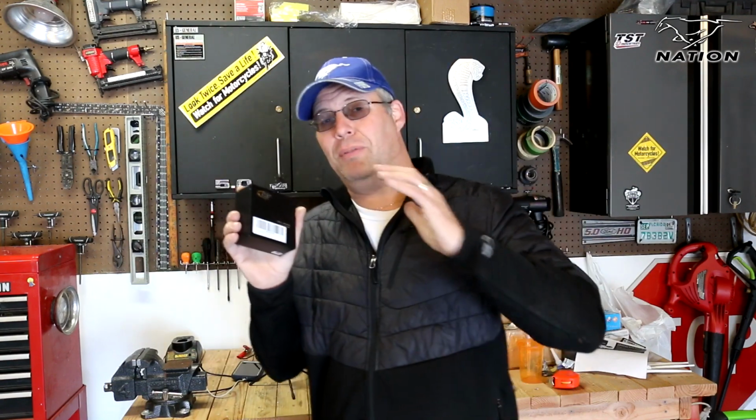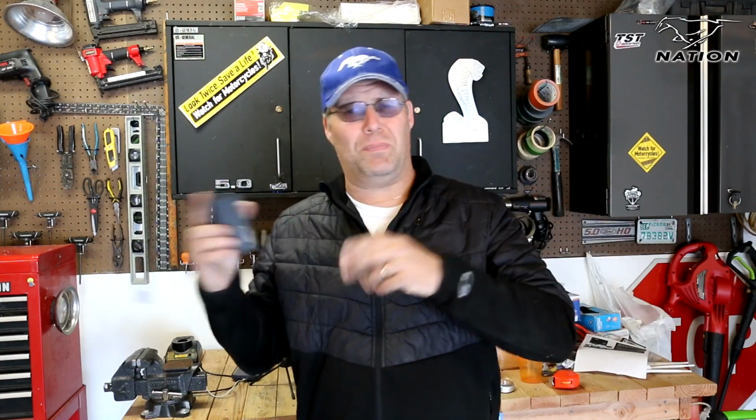And honestly, these things were less than 20 bucks, and it was a plug-and-play install. It shouldn't take you any more than 10 to 15 minutes to swap out your stock bulbs to these. Direct fit, no wiring changes, just unplug and plug them back in. And since they are LEDs, they should have a greater lifespan than the halogens and use less power.